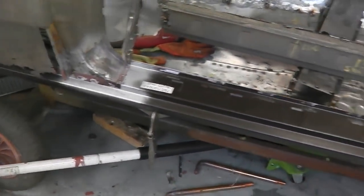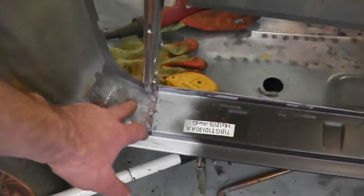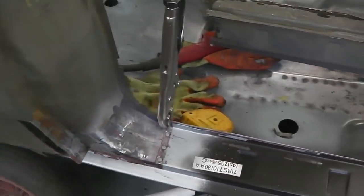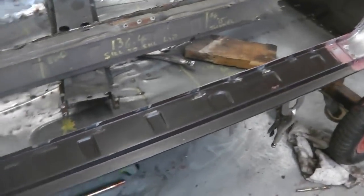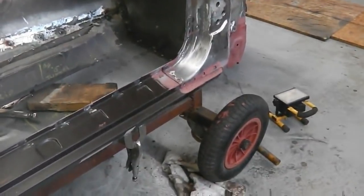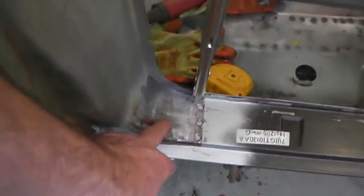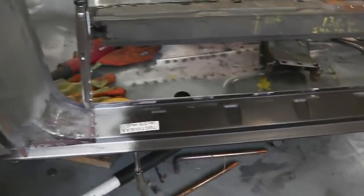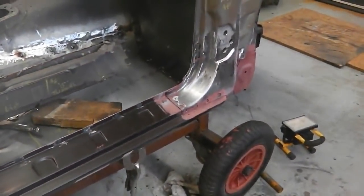So then, it's plug weld time, and then it's clean up time, and then I'll put some of the alloy fill into that, even though the body shop are going to go over everything, because all these areas will be pointed out to them where they'll cast their magic eye on it. It's more for me to see how the finished product is, and the body shop may leave it in, my skim might be fine, but it's all up to them. These areas will be pointed out, using the video as reference material.